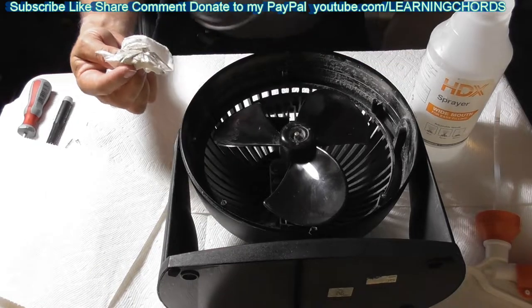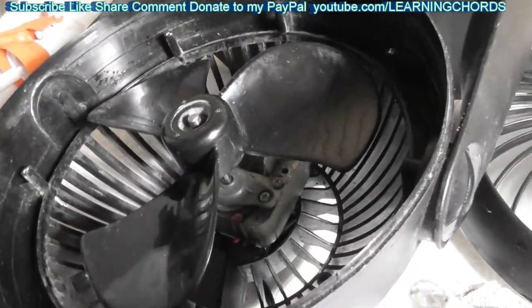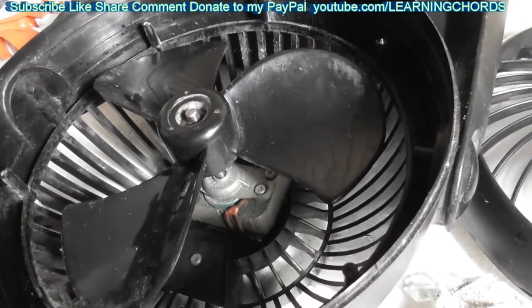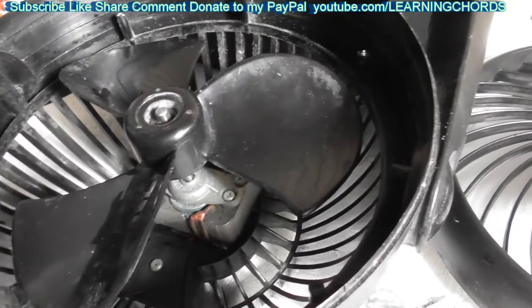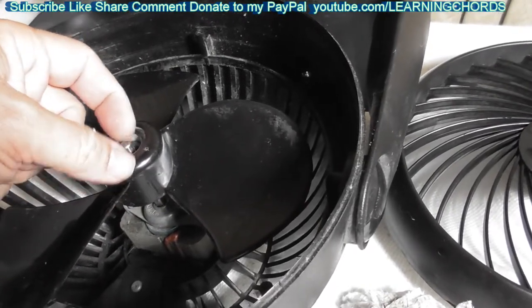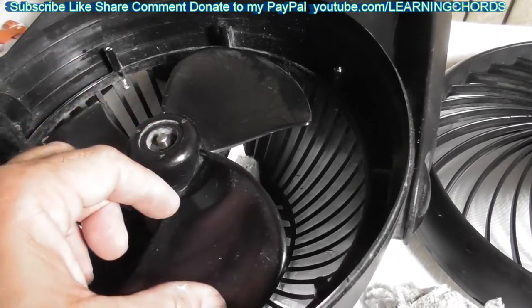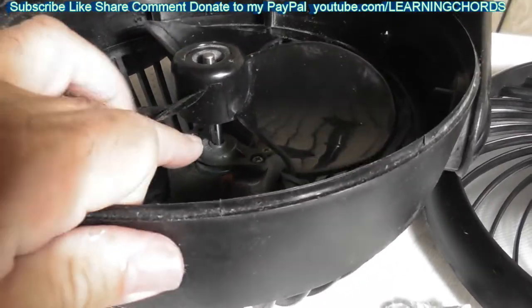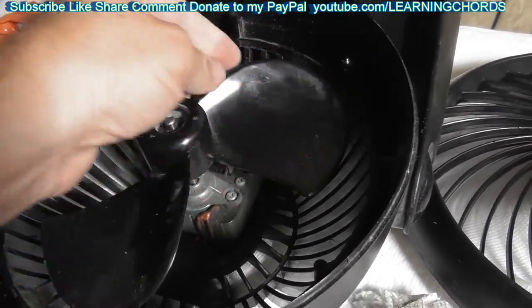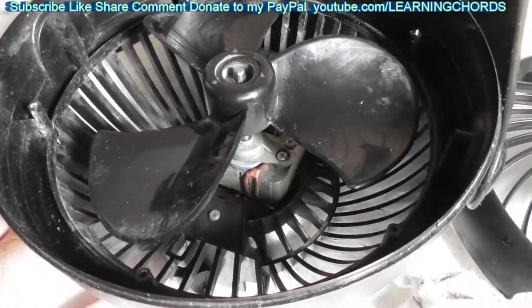Back from the cleaning. I used a brush and some wet squares of toilet paper to clean a little bit. The problem was my shaft was dirty. I used a little brush I was able to get behind this hollowed out piece — a lot of dust on my shaft. I was able to get the brush in there and remove the dirt. There was a massive amount of dust right on my metal shaft. I used the brush to clean that off, and once I removed all that dust and cleaned it up, I plugged the fan in and it just started turning without a problem. No hesitation.